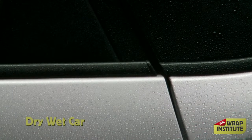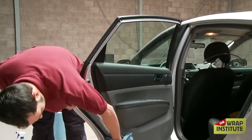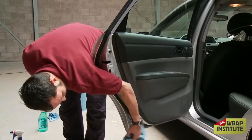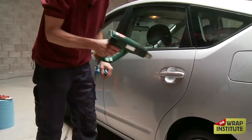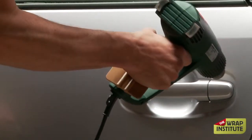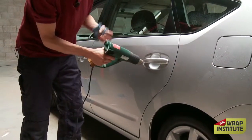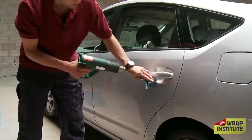If the car does show up and it's wet, here's how to dry a wet car. It's really important to dry a wet car because all that moisture is going to stay underneath the molding. One way to do it is by hand — you really want to dry deep inside the body of the car, because a lot of water stays inside there and that will drip, especially onto the running board. Then you want to take your heat gun and heat any kind of area where it's really tight, like around door handles, molding, gaps between the bumper and the fenders.